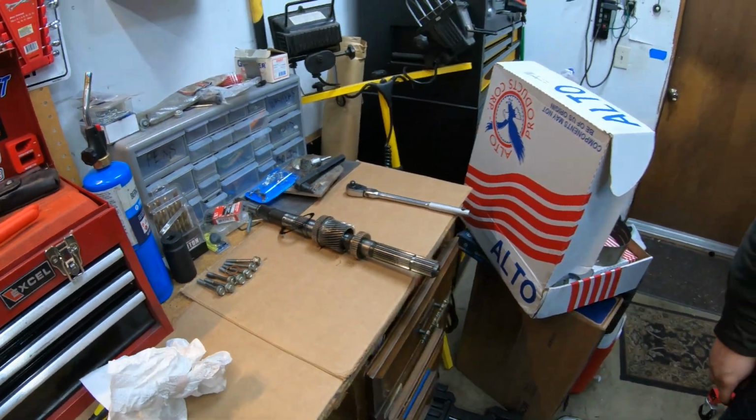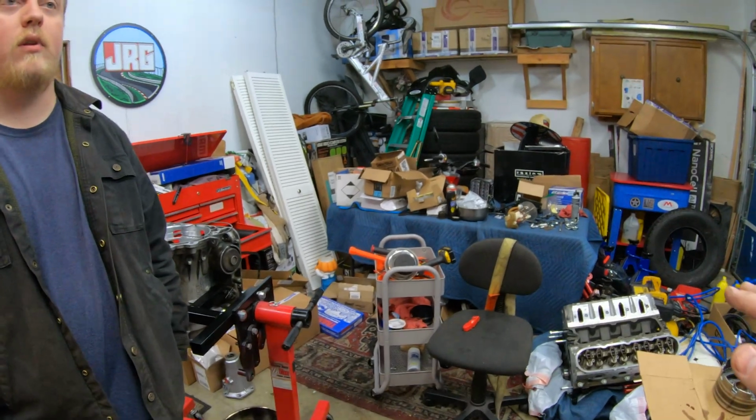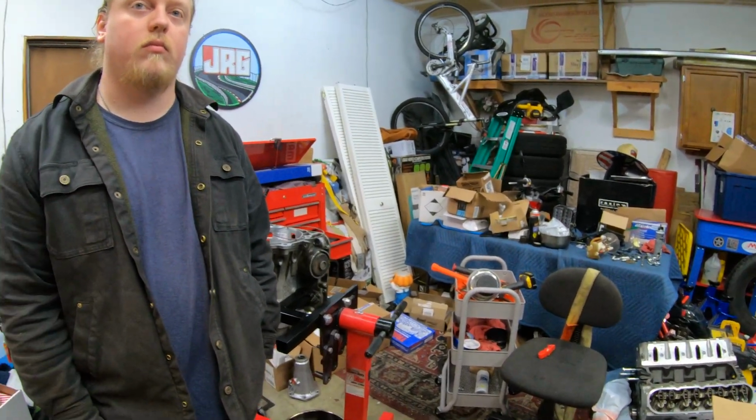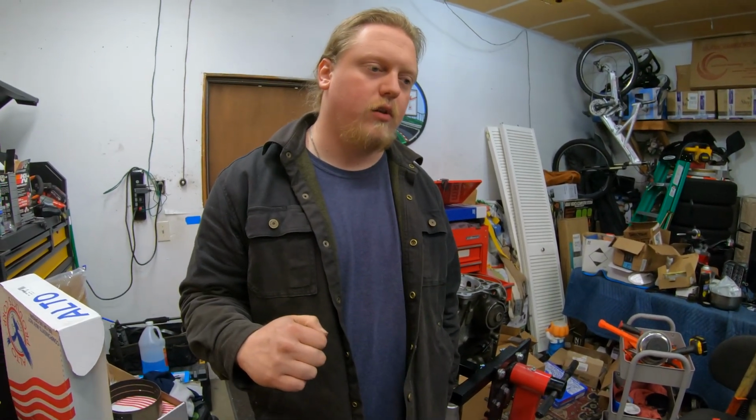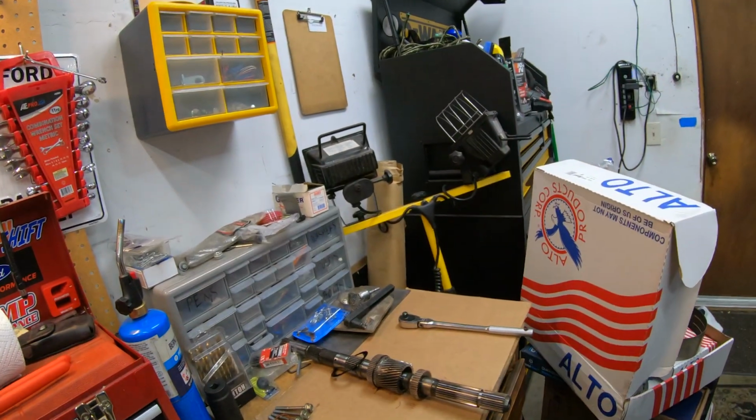He was also saying the sun shell goes out when you're going from reverse, like you're reversing out and the car's still in motion, putting it in drive. Do a full stop and then go to drive. You're putting stress on your sun shell, so don't do it. Yep. So be patient. Take the extra half second.